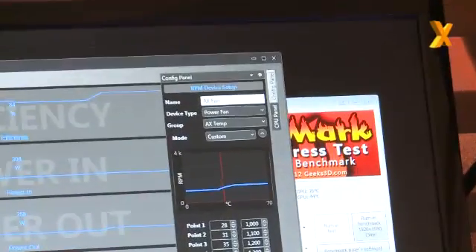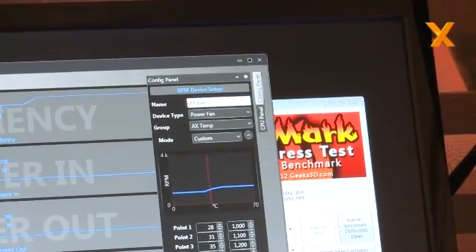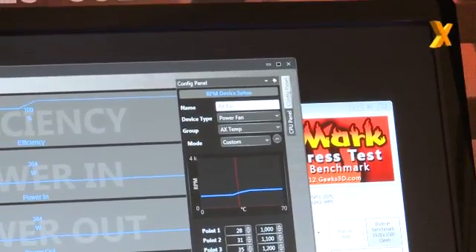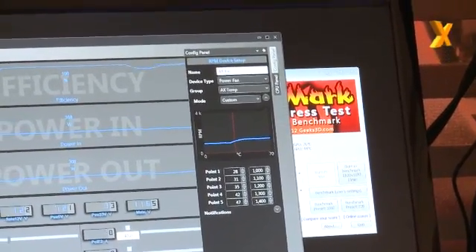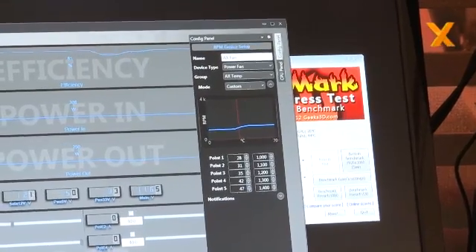Because it's digital and we were able to put this feedback loop into the power supply and be able to adjust it, we were able to do it in software as well. There's a way to do some data control without going digital, but it's a much cleaner solution and you can do it much more actively with this. You can also change fan speeds — by default it's in quiet mode, which is the fail-safe level, as quiet as possible. But if you'd like to use the PSU fan as an additional case exhaust and bump the RPM up, you can certainly turn it up much higher.